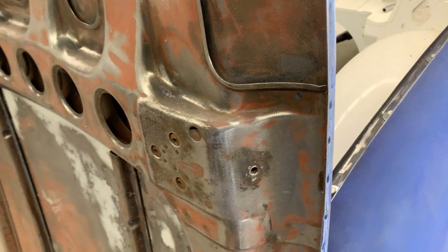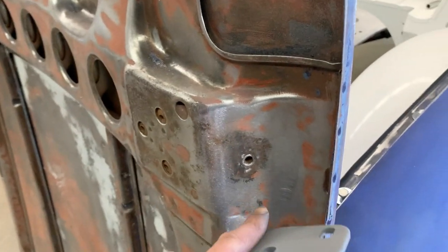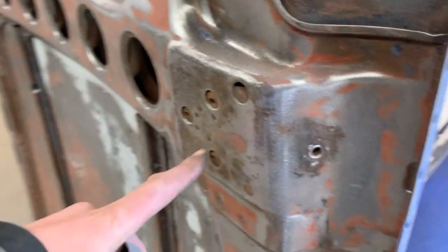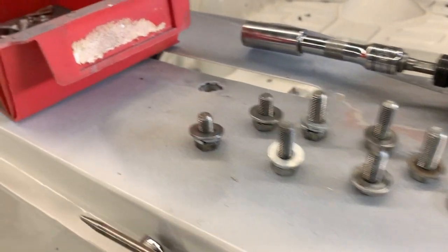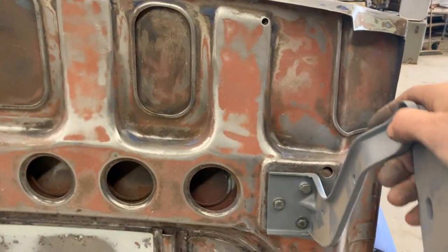And as usual, I'm just gonna remind you here that these three fasteners cannot be way too long because they can poke through the outside, but specifically this one here on the side should be a really short one, because if you see, the thickness here is very small on this size. And I've seen many TR6s and even TR4s with a little nib right here. So this can be longer, like I think they are about an inch, but the ones for the side are this long.